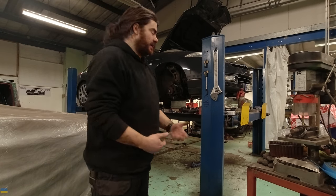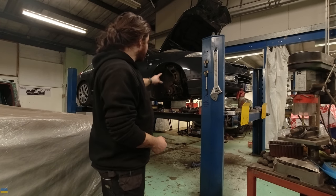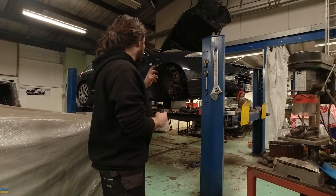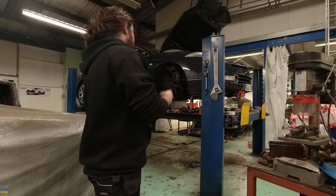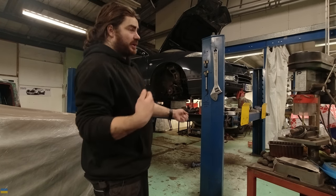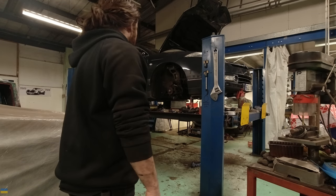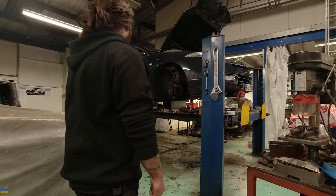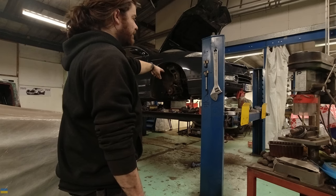The wheel bearing really held me back but I've just cracked on and got a bit more done to try and get the thing off the ramp. The wishbone for the driver's side and the bushes for that are on and fitted. The new drive shaft's in. I've replaced the bolt that retains the drive shaft - the one that wouldn't come undone. I've done the steering rack boot. I had to disconnect the brake hose because I refitted all the upright and then found I hadn't passed the brake caliper through. So it was either take it all apart again or disconnect the brake hose, lose a bit of fluid, and bleed the brakes - and seeing as I don't know when the brake fluid was last changed, not the end of the world. So now really all that's waiting for is a track rod end, the brakes, and the last fittings.